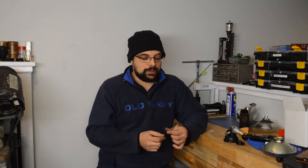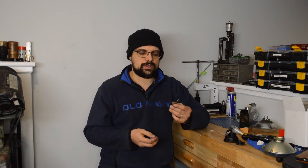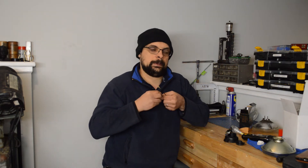If there is any issue I'll just crimp it off, strip the wires, solder it, and heat shrink it. For now, these little connectors I pulled out of the H4 sockets — I'll put a link in the description for all this stuff — I think they're about six bucks, so three dollars aside, not bad. I still get to keep a spare just in case. They're actually pretty decently built: ceramic housing, pretty thick gauge wire, and a rubber overmold that you can slide on. It doesn't make it fully waterproof but it makes it reasonably protected.